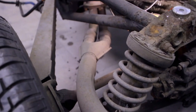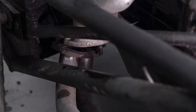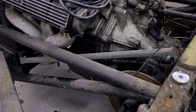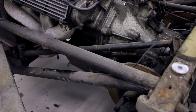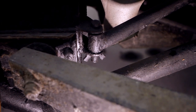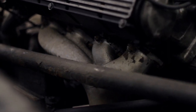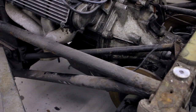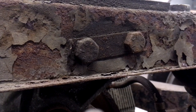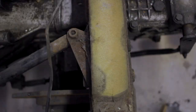The rest of the exhaust is the flexible joint, the mid box, and the collector that run up to the cast iron manifold. Everything so far is coming off very easily. In the chassis are two brace bars, one on either side — they're removable, mainly so that servicing the engine and getting it in and out are possible. On the near side, which is the manifold side, there's a butterfly nut which must have been put on afterwards — the manifolds being cast iron while the block is aluminium, they heated and cooled at different rates and would often work loose. The other end of the bar is held by two fairly robust bolts with tab locking washers, but somebody's put this one back on the wrong way round or with extra washers, which just renders it useless.